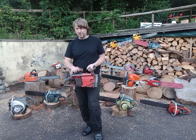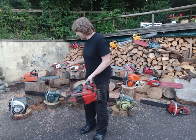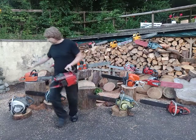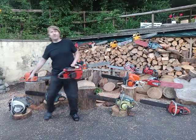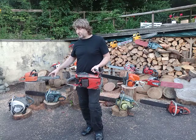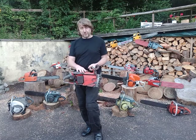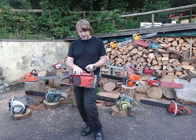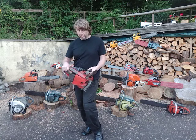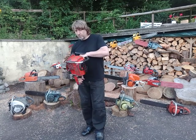And I think these are an unusual number, and I tend to remember it because something like the Logmaster, the SL5, that's a 2.0625 piston. That's 2.06. This is 2.0625. So I think this is a nominal 83cc saw. And what was I going to say about this?